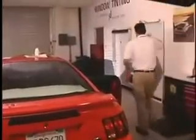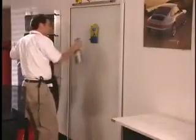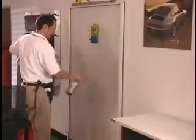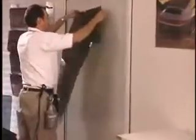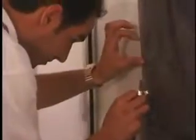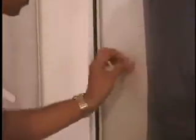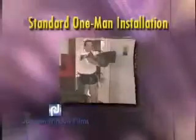Remove the film and carry it over to your glass wall. Mist the wall with solution. Then mount the film while you prep the inside of the car window. If there are any fine pieces that need to be cut, do so now. The smoother the cuts, the easier the release liner will come off the film. Your pattern is now ready to be installed.